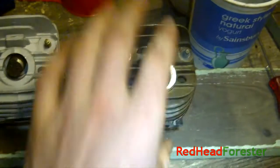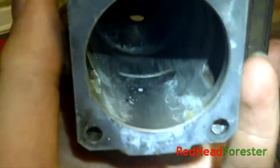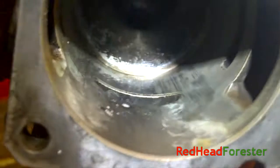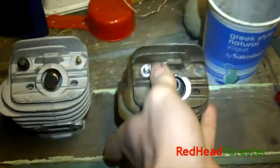This OEM one I've completely knackered. I left it sitting for several days with toilet descaler in it to remove the aluminium residue, and that white spot just below the exhaust port — that's actually a very deep dimple where there was a little lump of aluminium, which presumably was stuck on because it had worn through the coating. There was no actual bad scoring in the cylinder — it was just on the piston — but I've now completely wrecked this cylinder, which is a bit of a pain, but a learning experience.